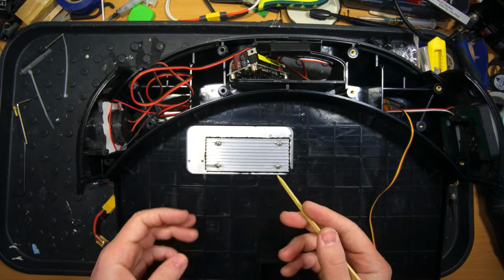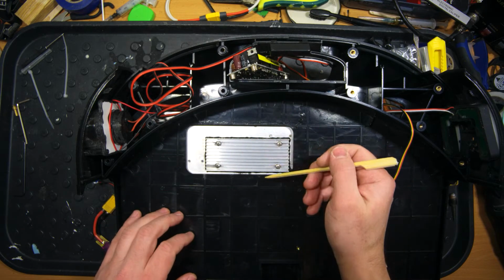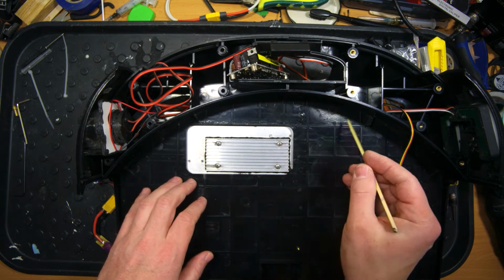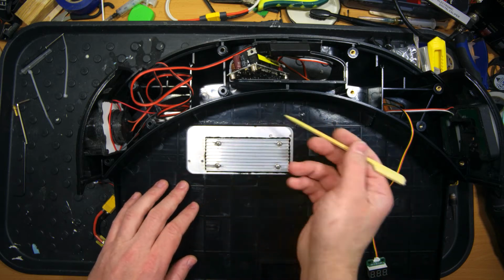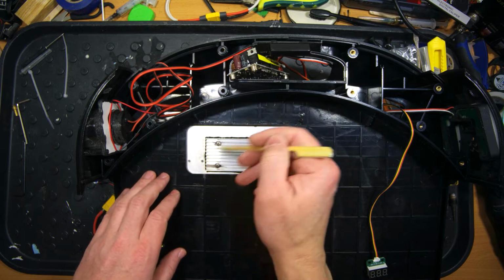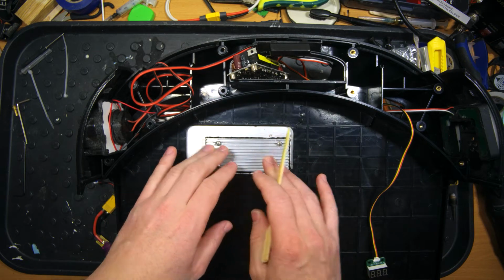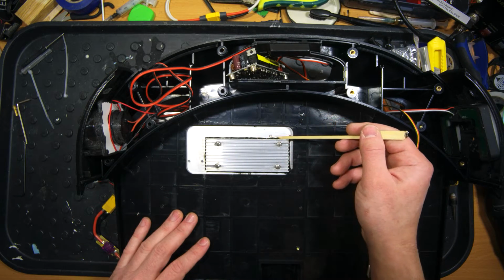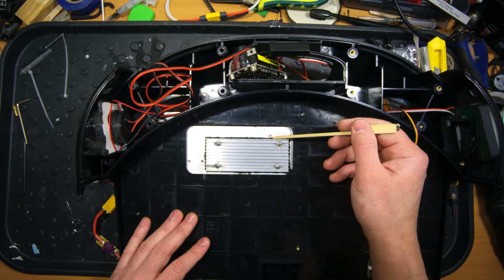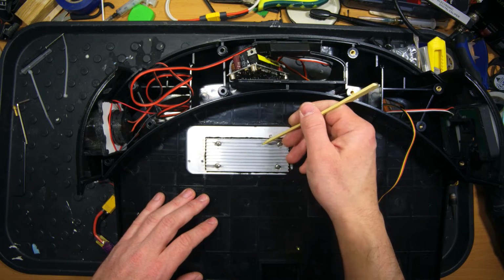That's how the installed heatsink looks inside the wheel well. I moved the heatsink a little bit down and to the right side because here we have the tire, which will rotate and there will definitely be a lot of sand and dirt particles flowing around here. So I'm pretty sure this is the best place for the heatsink to be installed. On the side of the heatsink I've covered the adjacent areas with sealant to avoid any water or road reagents ingress down to this heatsink.